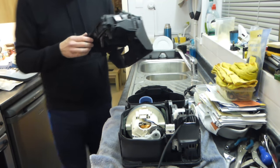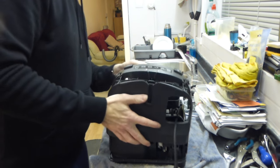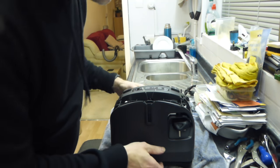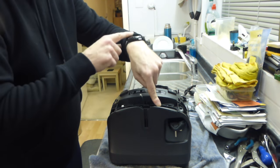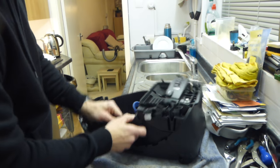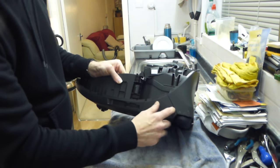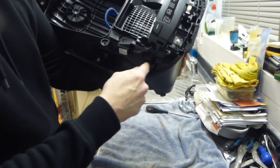Here's our electronics. We're going to lower this back on. First of all put the plug through like so, then just lower the top straight down onto the machine so that the connector connects itself through. If it won't go in easily you're not doing it quite right — vertically straight down. Making sure we're all down on the front and there's no big gap. Then put the one hidden screw back in the hole there.